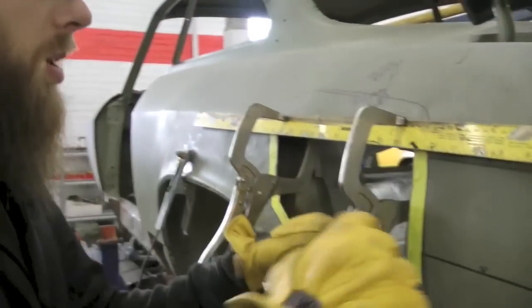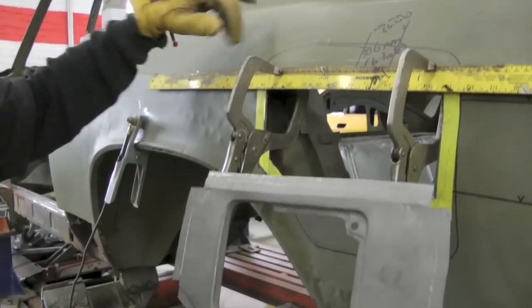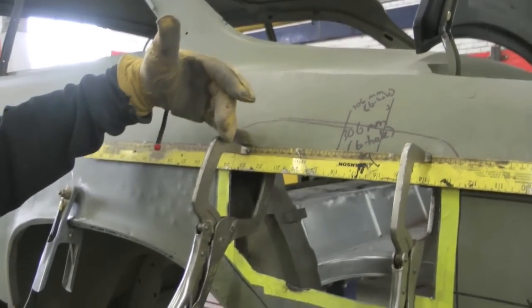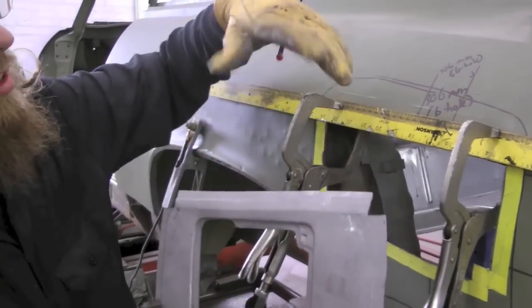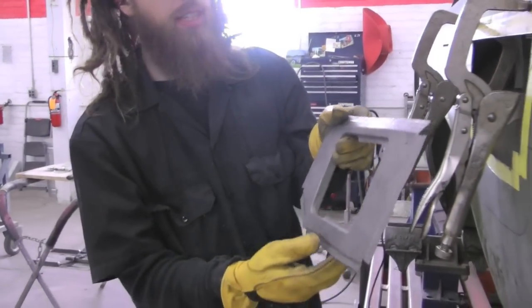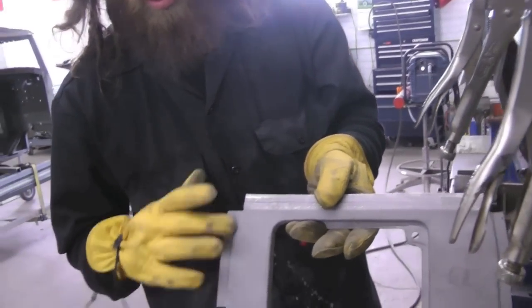At the moment I've got everything outlined for where I'm going to put my new filler door. I've scribed up a couple of marks that I'm lining up this straight edge with, and I'm going to scribe myself a line across here. What that's indicating to me is where this flange is — that tells me how far back on this metal I need to cut to get everything to fit. This piece is actually going to come in from the back side and we're going to lay it up.